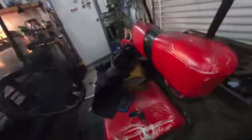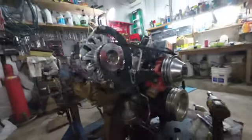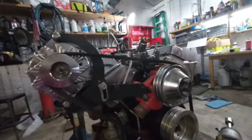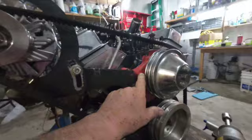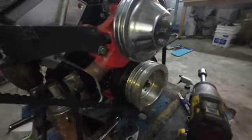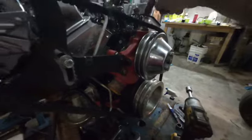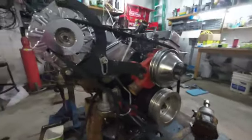I went back to what I was working on. These parts are going back down to the Chevrolet parts storage area. This is the thing I had on here last time, which worked pretty good, but it seemed like it sits way up high on the side of the motor. I thought if I could tuck that alternator in a little bit it would be better. Plus I had to use this pump because the chrome-plated pump only has one outlet, and you can't get a heater pipe on it. This pump has the water outlet on top, so I can get a heater line on this.